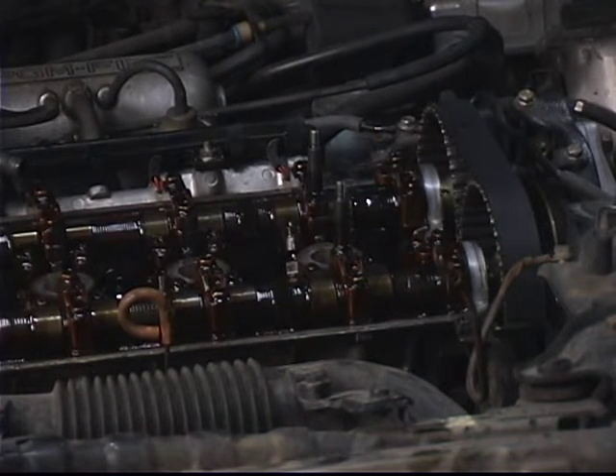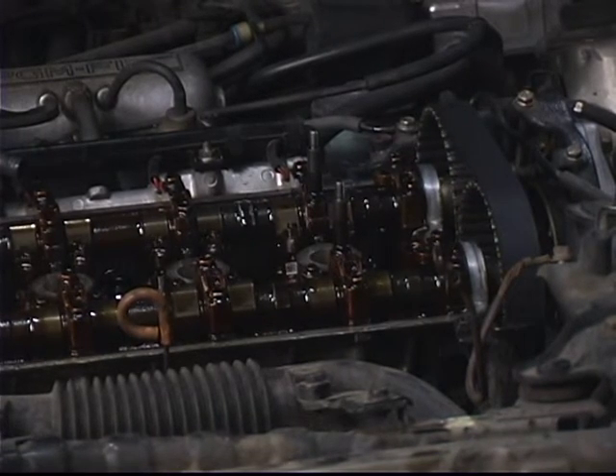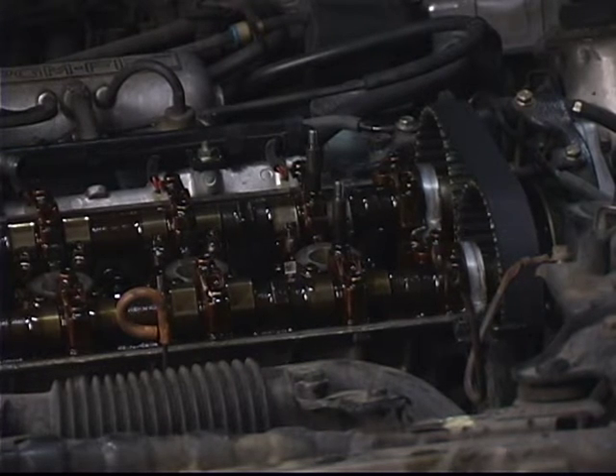I'm having a little difficulty getting past compression stroke — there it goes. If that's a little difficult for you, you can remove the spark plugs and the engine won't develop any compression, which makes it easier to turn over.